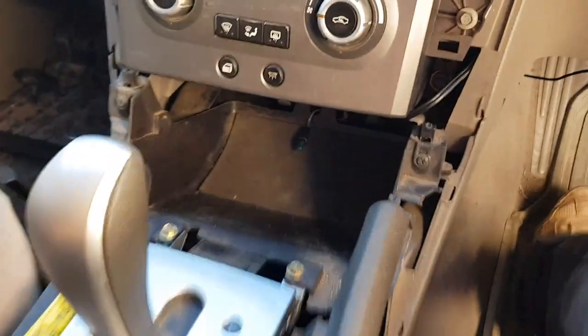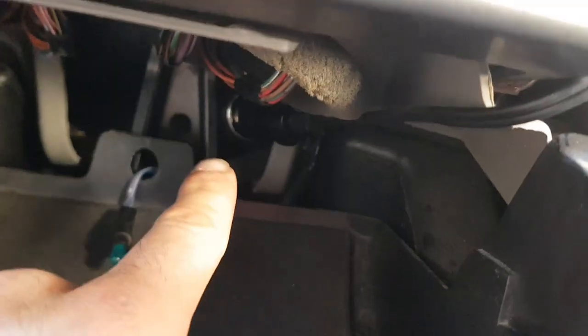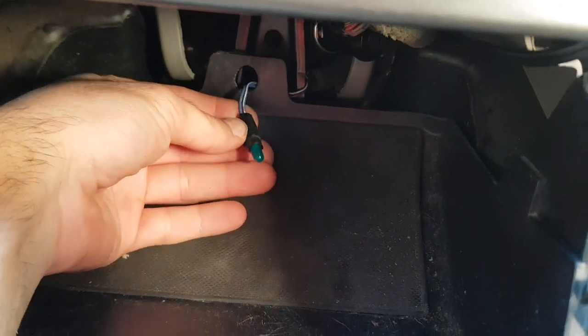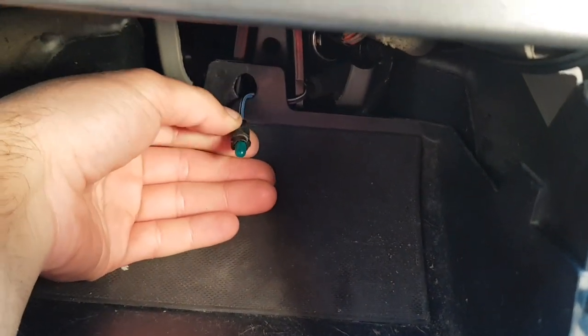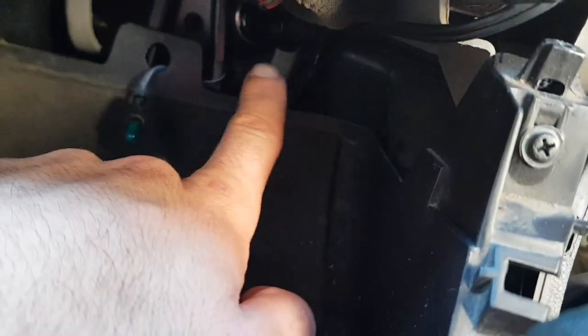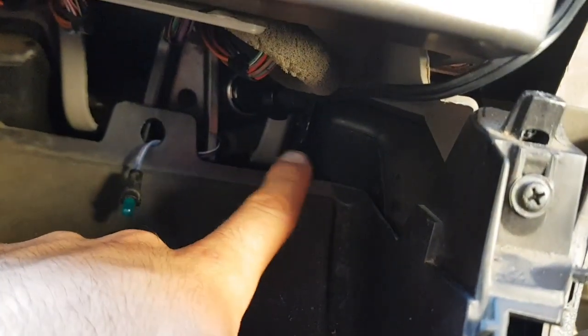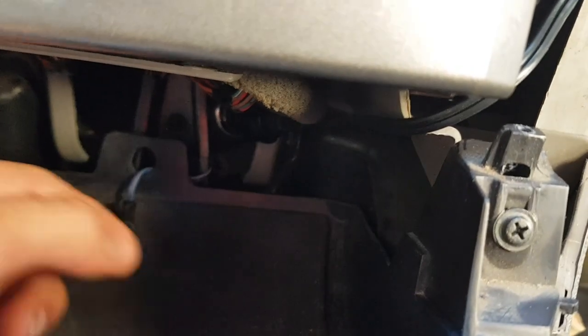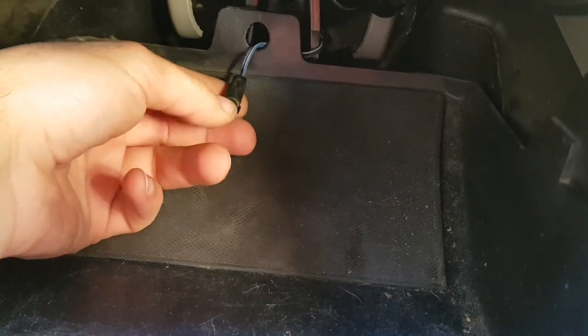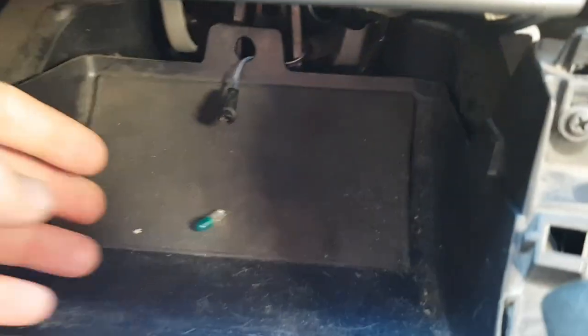Normally you'll have your wiring connected to the back of the cigarette lighter there, but what I've done previously was relocate mine behind the dash. As I mentioned, this is the wiring plug — the bulb holder that was taped up to the original factory cigarette lighter wiring plug. You untape it and then you get access to this little holder.